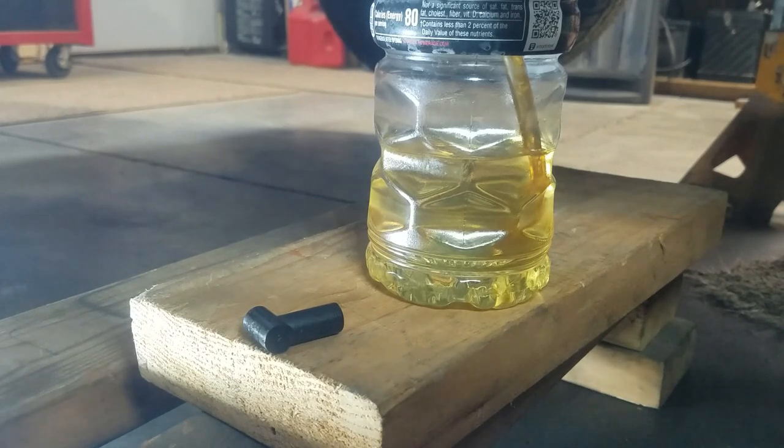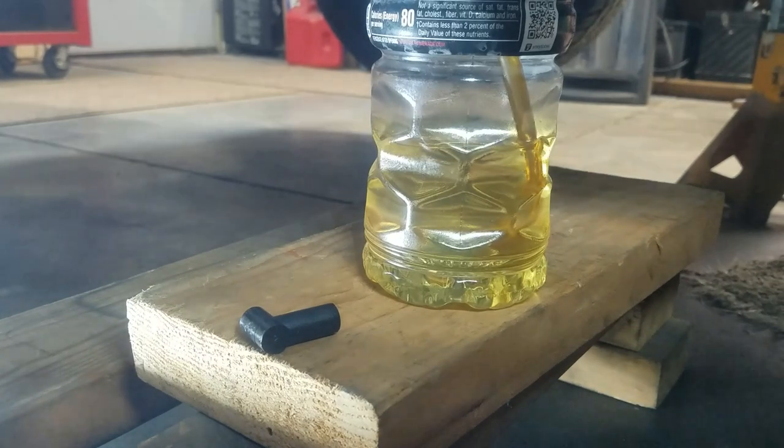So this is one of those things that takes patience when you're working on a car, especially when you're starting with such a dry system. There's nothing in the line between the master cylinder reservoir and the master cylinder, and from the master cylinder to the throwout bearing, there's nothing in it. So, let it sit there for a second. Now, there probably won't be this much air if you have the reservoir attached to the master cylinder itself, because you don't have that extra hose to go through.